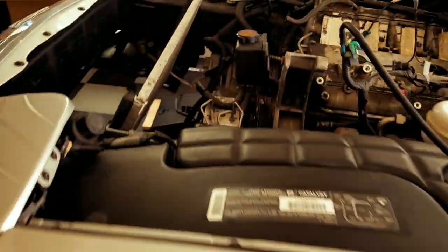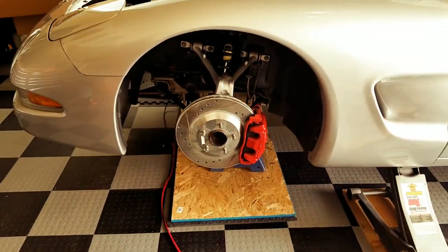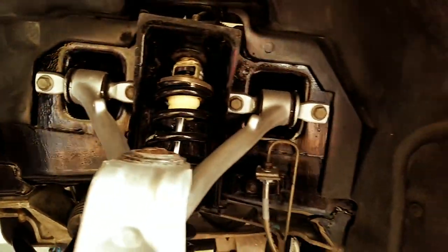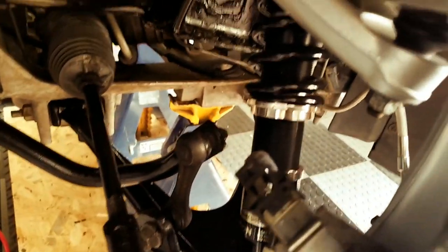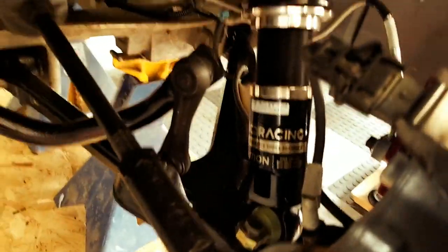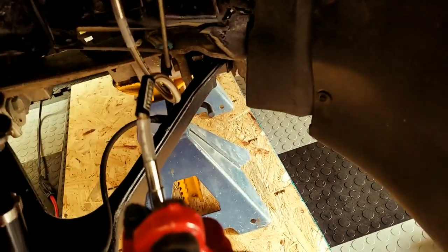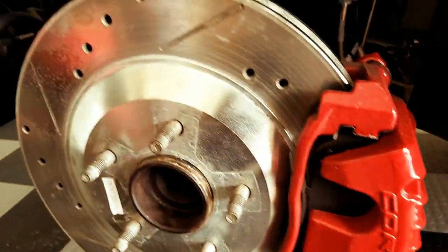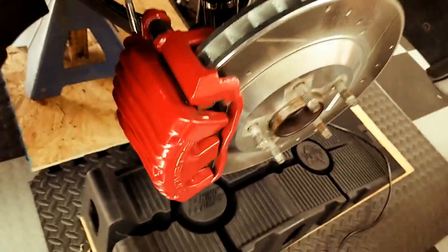Time to remove the steering rack — I already put the car up on jack stands. While I was at it, I don't think I ever showed you guys what I did with the suspension. All the rust has been removed. Took everything off, painted it either black or silver. I got rid of the leaf springs and put in BC Racing coilovers for independent suspension. Installed new brake lines and painted the calipers red, along with new rotors. Both sides look the same.